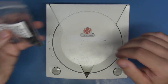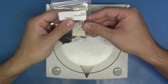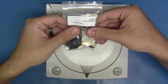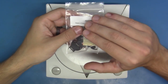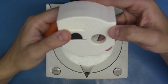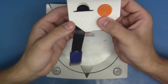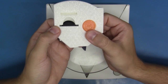We're also going to be servicing the system, which includes the power supply. We have a cap kit here that we'll be using to service that. In addition, we'll also be doing a brand new, never before seen battery mod using just a plain old CR2032. This option will not only be less expensive than all the current options, but will also afford you longer battery life. We'll also be doing the GDMU install, and this beautiful 3D printed part designed by Greg Collins over at LaserBear Industries — one of the best in the business. If you have a GDMU, you really need this part.